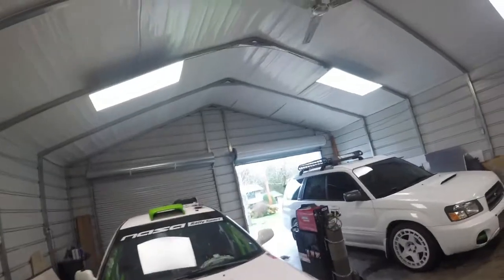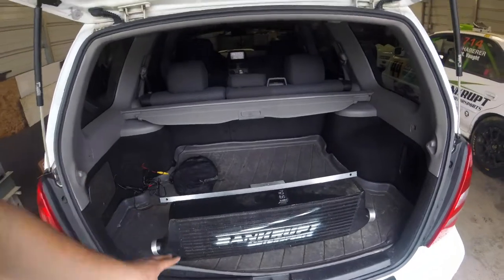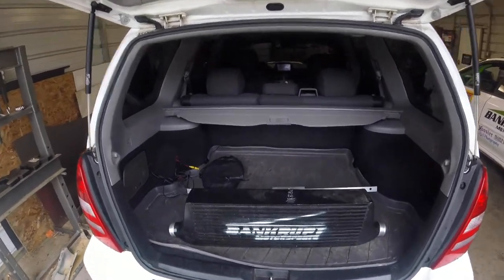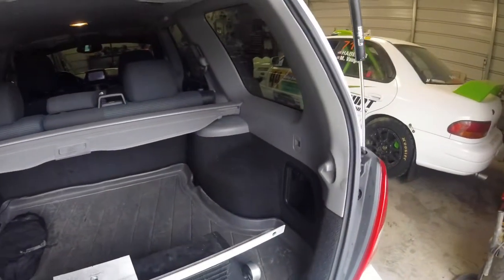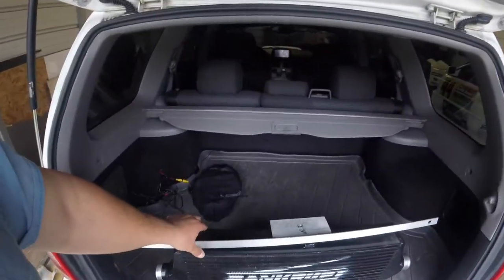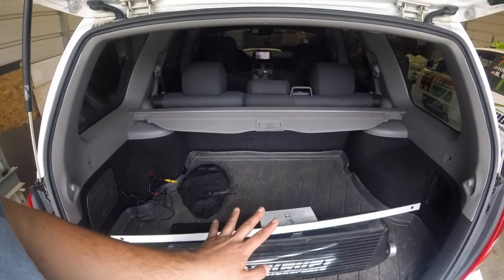The Forester's back looking good. Let me show you the old intercooler we had — just in case you forgot, this is the Turbo XS slash Rev 9 kit. I painted our logo on it. This is a really nice, super affordable kit — like 500 bucks on Amazon with everything: coolant reservoir, all the pipes, couplers. It's not the highest quality; the bracket that comes with it is garbage, actually made for an STI. But if you make one of these, it sits on top and uses the factory screw mounting. This will adapt to the Forester frame rails to fit — the WRX ones are shorter, that's really the only thing you have to change to run this in an SG Forester since they don't really make kits for these. This one is three and a half inches thick, about 23 inches long and eight or nine inches tall — really good up to about 500 horsepower.